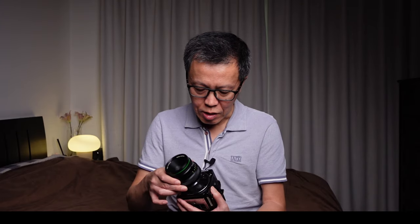To remove the lens, you press the switch on the side of the camera and twist like a normal camera. But one important thing: you won't be able to remove the lens if the shutter isn't cocked. If the mirror is up after taking a picture, removing the lens would expose the film to light. The shutter inside the lens is what stops light hitting the film. You have to wind the film on first so the mirror drops, and then you can remove the lens.